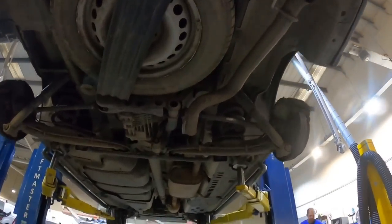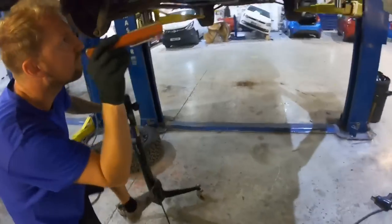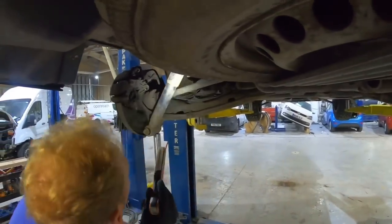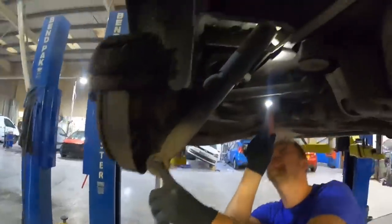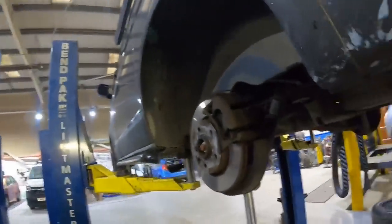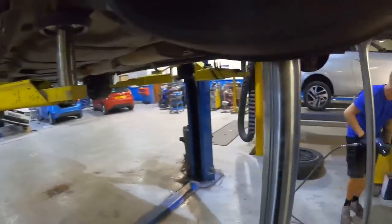Here's the underneath of the motor - they look horrible underneath don't they. This support here is just to hold the spring when I drop the shock. So we do the shocks first - we've got to undo this one here and then the one at the top which is up there, and then this side as well. Yeah, we can drop these springs out. You need a 21 mil spanner and a socket on the other side.